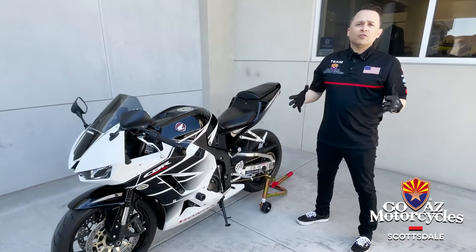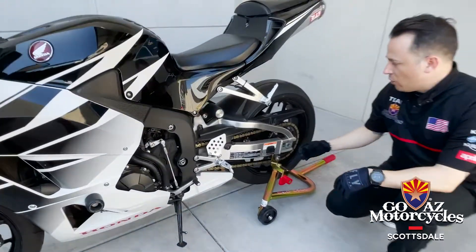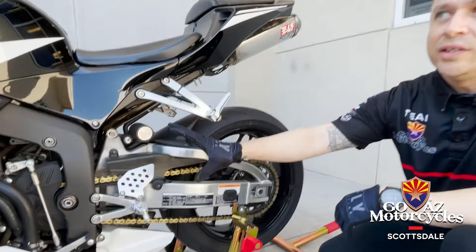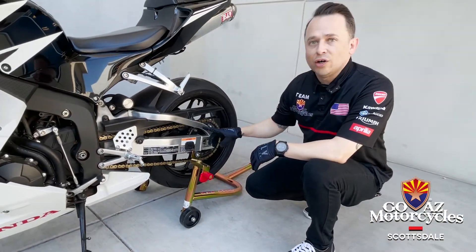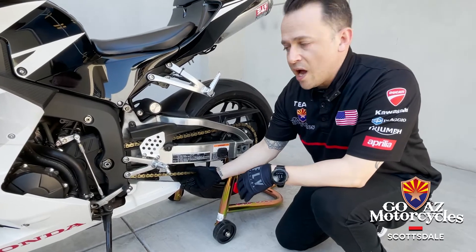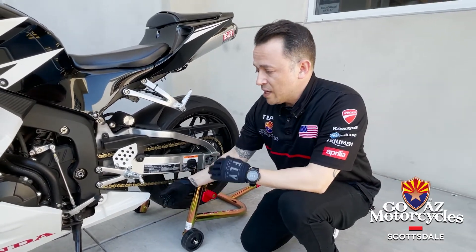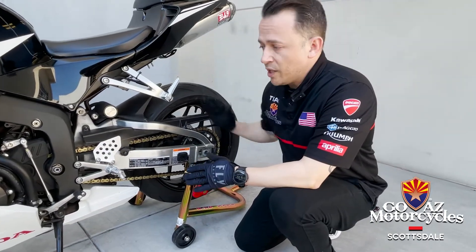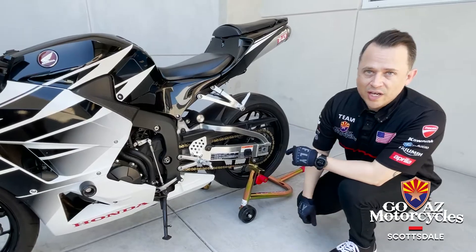After we've got our tire pressure checked, we know we've got fuel, our battery's good, our keys are in our pocket — we want to make sure we've got our drive chain checked out. We're gonna do a visual inspection: our sprockets are still good. We're not gonna be able to see our countershaft sprocket on a motorcycle like this, so we'll rely on keeping track of it by mileage and by the teeth and wear on our driven sprocket. We also want to keep a good eye on the deflection of our chain. If it's too tight it's gonna bind up our transmission and damage the bearings. If it's too loose it may be time to adjust or replace the chain, and it's gonna prematurely wear out our driven and countershaft sprockets — that's gonna be loud, noisy, and we don't want it to break and damage the bike or hurt us.